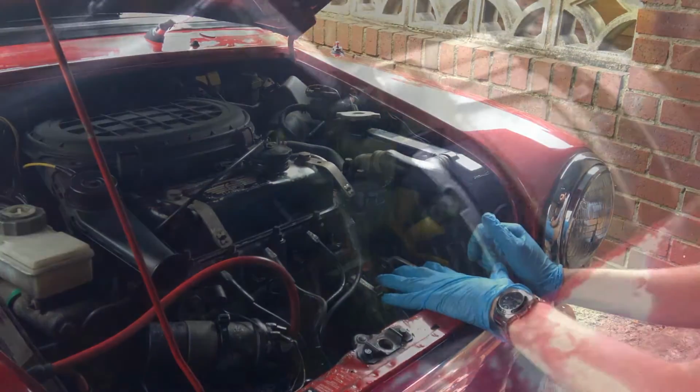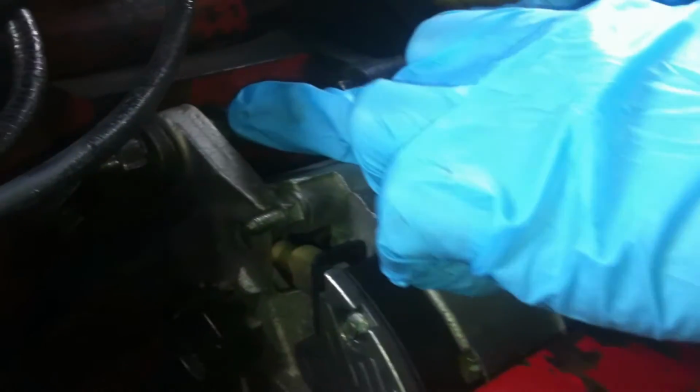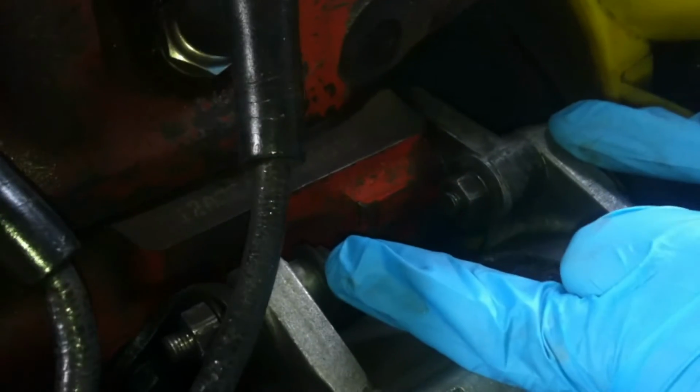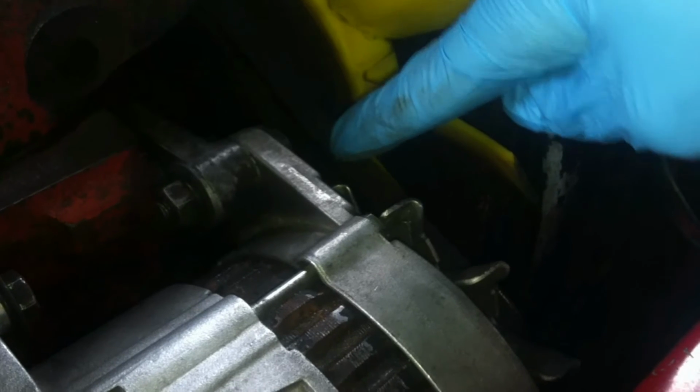take out the alternator. To take out your alternator, you're going to have to take out this cable here, and then undo the adjusters right underneath the alternator. You should be able to feel it with your hand just underneath. Once you've undone them and loosened it off, you can unbolt it from these two bolts here and slip it out. When you put it back in, do the exact reverse, but tighten the adjuster at the bottom so there's 13mm of leeway when you push down here.